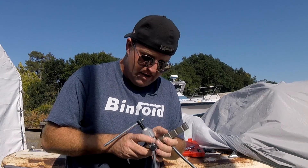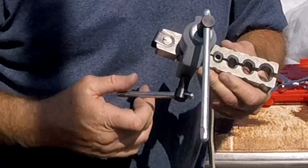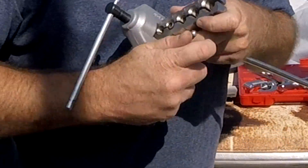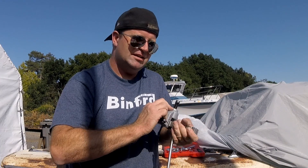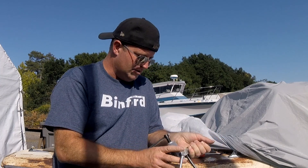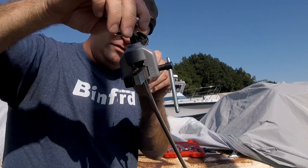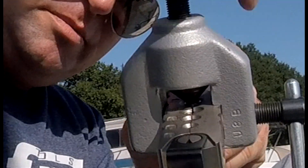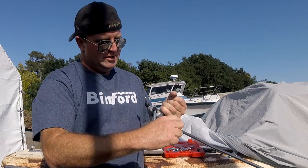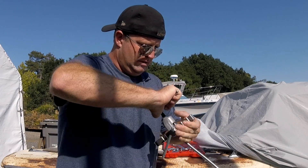Fit it in there and this slides on here. One thing I had to do when doing the fuel lines — sometimes to get it really clamped on tightly, I had to crank this one down and it kind of squeezes the bracket around the tube a little bit, then you can slide it the rest of the way. I'm moving the die down into the tube there. Tightening this one is important because it grips the tubing and prevents it from sliding out of the rack. Then we just crank this down.